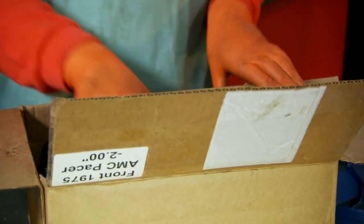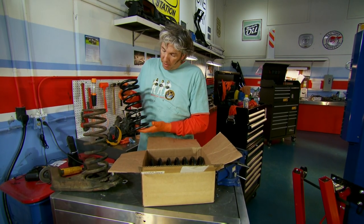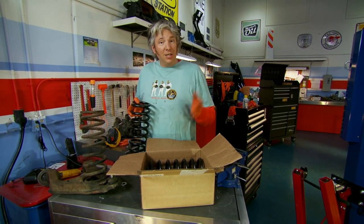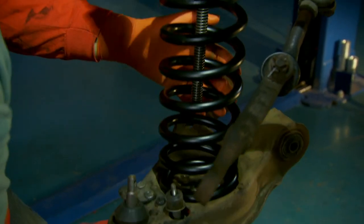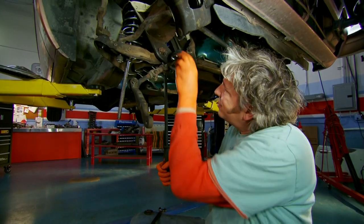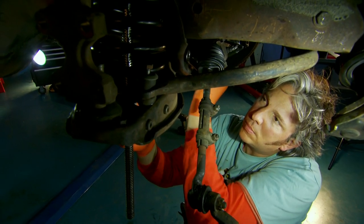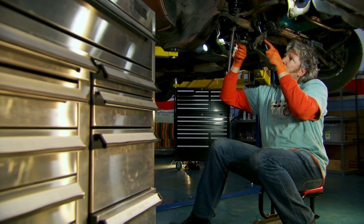And it's time for the new springs. These have been made to my specification — they're going to make the car 50mm lower, but obviously also much stiffer, so it's going to tighten up the way the car drives, which it really does rather need. There's a myth that you can just cut down your old springs, but it's not true — in fact it's dangerous. Springs have flattened ends and a spring rate designed to guarantee a certain travel and performance. Cut them down and you'll never get a flat enough end for good location in the suspension arm, and you'll damage the ride of the car.